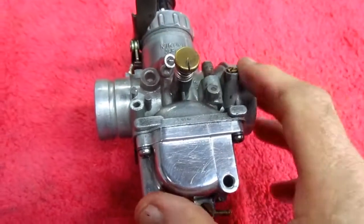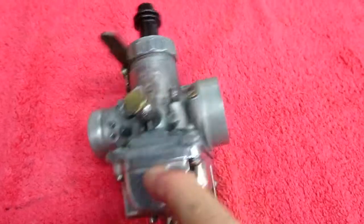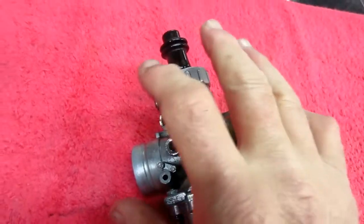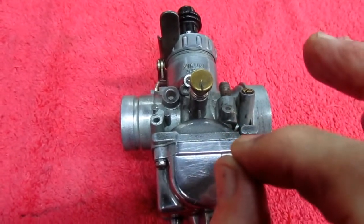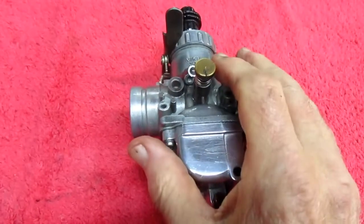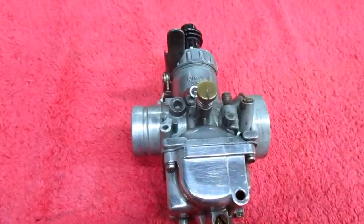So with the old carburetor out, I will of course put this in a clear plastic bag for storage for future whatever. But keep in mind what happens. This is a 44-year-old piece of aluminum. There's oxidation inside of it, and even though you clean it and you can wire clean the jets and you can replace this and that, overall this is just a little bit deteriorated over what it would be if it were brand new. And what I'm looking for with this motorcycle is that crisp little edge, and also that it takes the gas beautifully. I found from doing the restoration for Ray, when he bought the new carburetors for the bike, night and day better. So that's what we're hoping is going to happen with this.